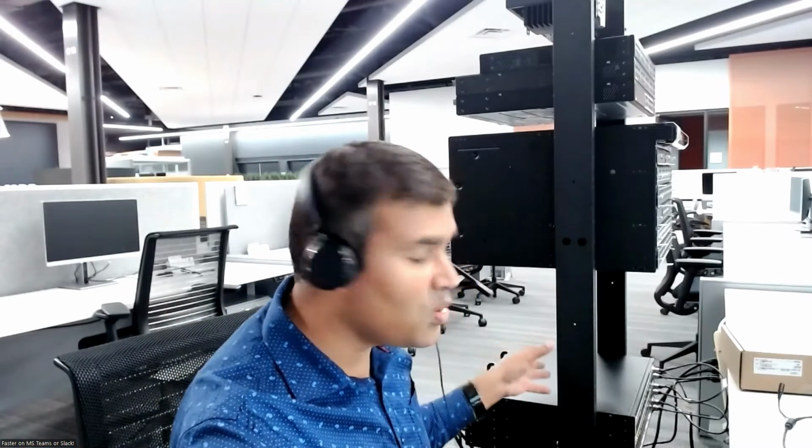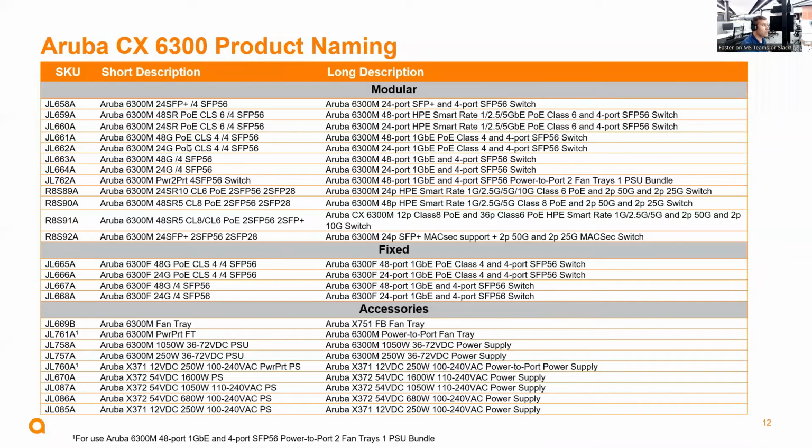There is a lot to talk about. It's not possible to cover everything in one video. I'm going to make subsequent videos to talk about a lot of features, but I just want to allow you to glance, as it is going to boot and form a stack, at the number of SKUs which we support on 6300. Take a look at this screen. We have Aruba 6300M with 24-port SFP with 4-port SFP56. That means 50 gig uplink, and the 10 gig downlinks you have on the access side ports. Like that, we have all these SKUs which you can see on the screen.